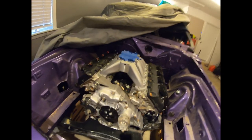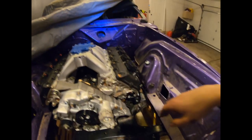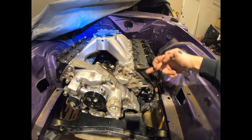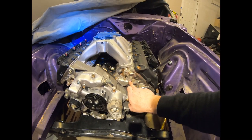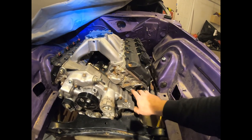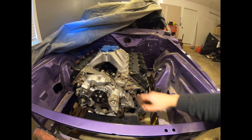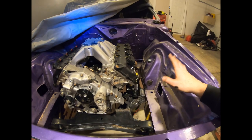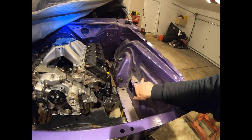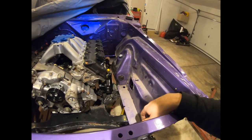The pump that I have with this car, it's buried. The truck cover came out like this, and it clocked it a certain way. Well, these holes are where it's clocked in a vehicle or in a car. If I put the pump on those three, the reservoir goes off like this, so it won't work. But I'm thinking if I can take the reservoir off that pump, because I'm pretty sure it's the same pump, I can mount the reservoir on this side firewall, or this inner fender well here, two real short lines, and I think I'll be good.